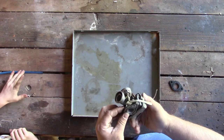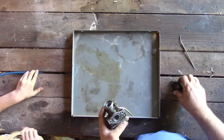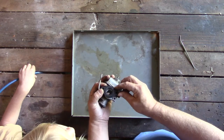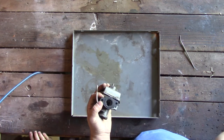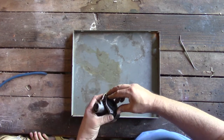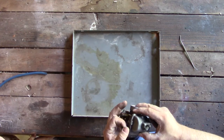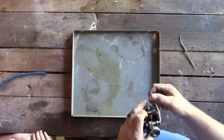That is a stupid engineering decision. We're going to have to find a way to get those loose to get in there and unclog the float bowl. Also I noticed another problem — this gasket here, when I took it off, this end wasn't under the bolt. So you see the gap it leaves? If it wasn't tight, it would allow air to get in. Remember how it was revving real high even when I left the throttle? That means it was probably getting too much air — this was just leaving that air gap open, just sucking air through here.